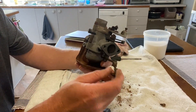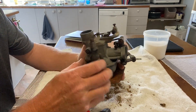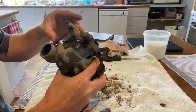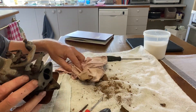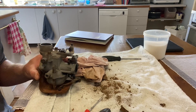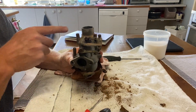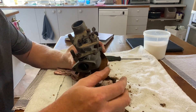Alright, so that's actually ready to go back on the tractor. I've got the fuel line bolt here - I have to replace the fiber washers that go in this. Everything moves now - it was all stuck before. The choke is moving very well, very happy with that outcome. Got the old clamp off, the old wire out, threw them in the bin - all done before the wife got home from work, happy days. Thanks for watching - this is a Solex 26 NH carburetor which you find on Fiat 411 RBs. Let's go put it back on.